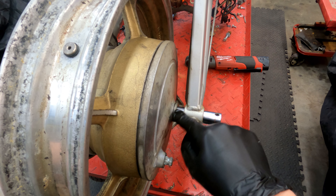That sure does look a lot better. I trimmed it off and then chamfered the end. It would have been nice to have a grinding wheel on my bench grinder and I could have just rolled it on that, but I threw it away or lost it, so I just had to do it with a hand grinder. Chamfered it, cleaned out the inside — perfect. I was thinking about drilling another hole in this to make it easy to pull out, but honestly I'm not sure I need to. It's going to be greased, freshly cleaned up, and you can just put a pair of pliers on it. There's enough material there to just grab with pliers, so I don't think I'm going to drill another hole through it.